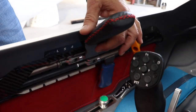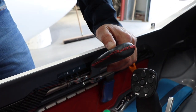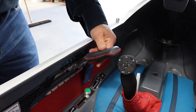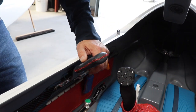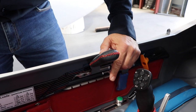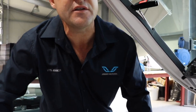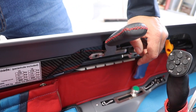Then we have flap three, which is your best L/D flap setting, defined as neutral flap. If you're really in trouble and would like to extend your glide to a glide ratio exceeding 55, you go to flap three at about 120 kilometers per hour. Then you have your two climbing settings — flap four and flap five. Flap four works very well in turbulent conditions where centering is required; advance to flap five once centered in a smooth thermal. We also have a landing flap, which reduces stall speed slightly to meet certification requirements.